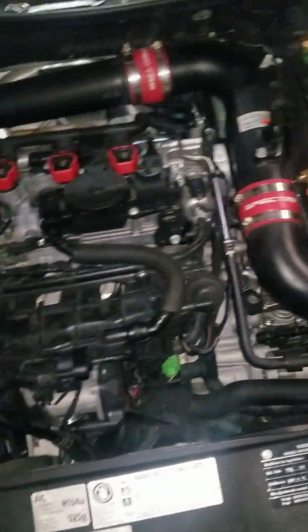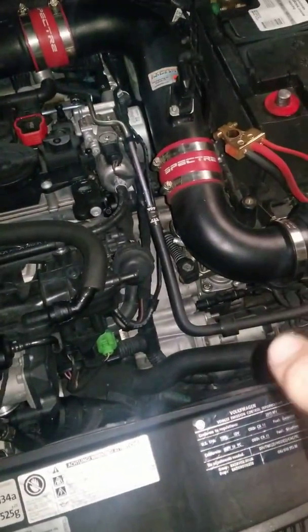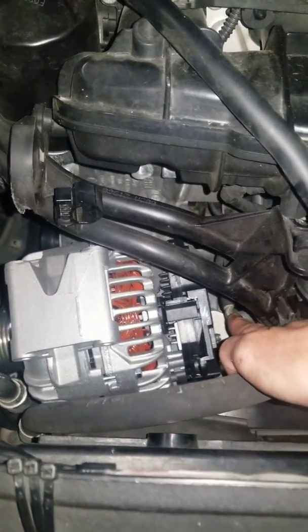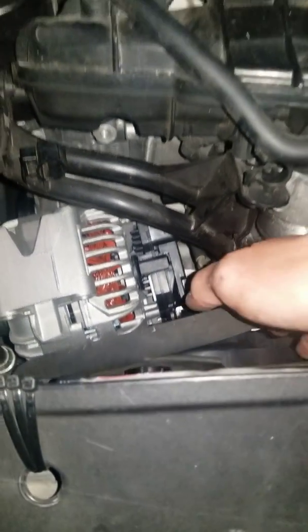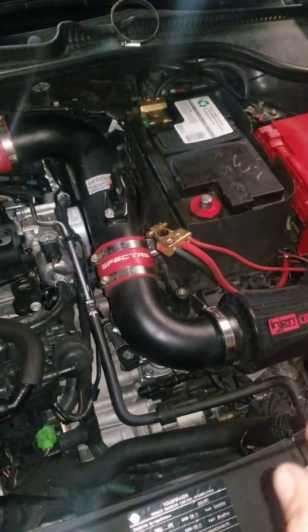Now for diagnosis — when you still have the battery hooked up — I have it unhooked now, because that's what you should do when you work on this. The first thing you should do is unhook your battery. Otherwise, your power wire for the alternator is going to be live. If you touch anything, you could kill the inline fuse or burn up some equipment. Make sure you unhook your battery before you start.